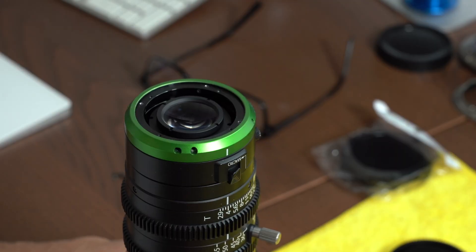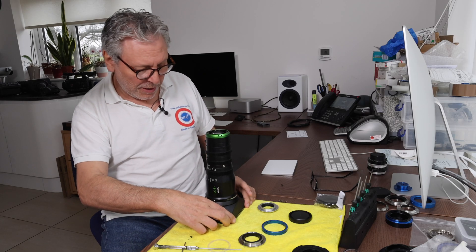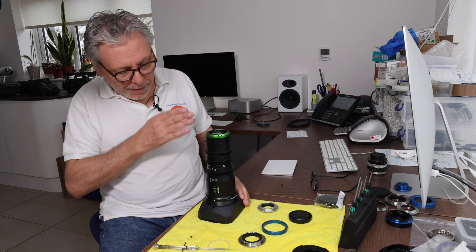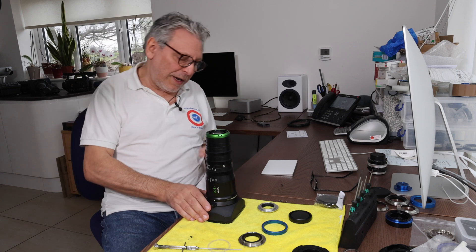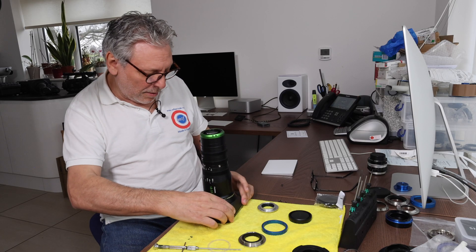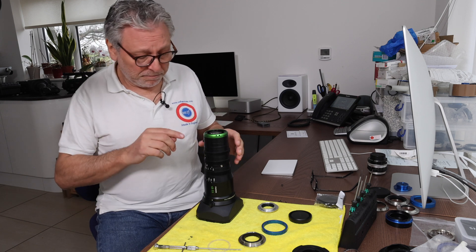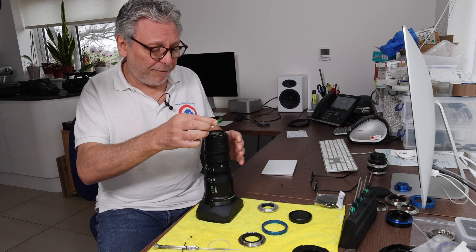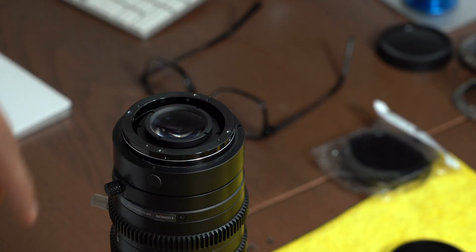When we work with the lens, we always have it sitting in front of us in a consistent orientation — working from the bottom or back of the lens. There are witness lines on the left-hand side. If you keep them on your left, then all the parts we put on will go in the correct position. Now that those three screws have been removed, the collar should just slide off. Keep that aside because we may need to convert back to E-mount at some point.